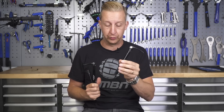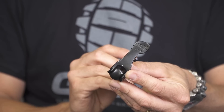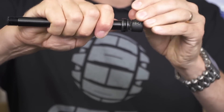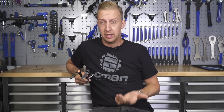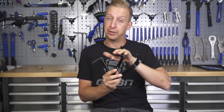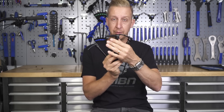There are a lot of different style quick-release through axles available, but here are three of the most common ones. First up there's the RockShox Maxle, seen in front and rear orientations for forks or frames. There's the Fox QR15 system, mostly seen on forks but also on frames — a very simple system. And there's the DT system, which you see on both forks and frames, with many manufacturers adopting it under different names. The RockShox Maxle and Fox QR15 both work on a cam-operated lever principle, while the DT system simply screws into the frame or fork.